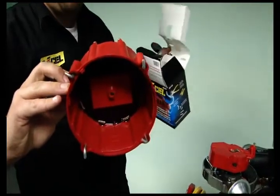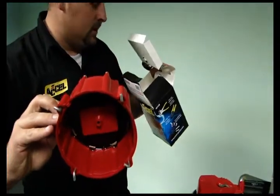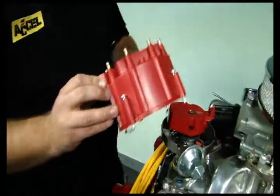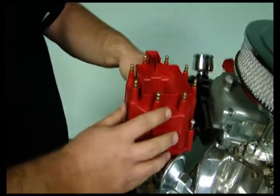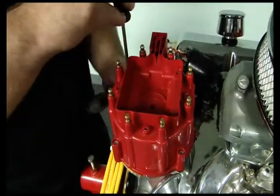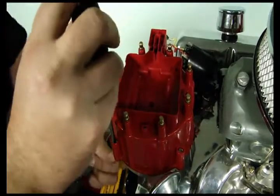It also comes with brand new hardware — a new washer, a pack of dielectric grease, a ground strap, and all the goodies needed to put it on. Installation is pretty much straight cut and dry. Put your HEI cap on there, find the index tab, put your little J-hooks on there and they grab right into the bottom of the distributor, so really easy to use.